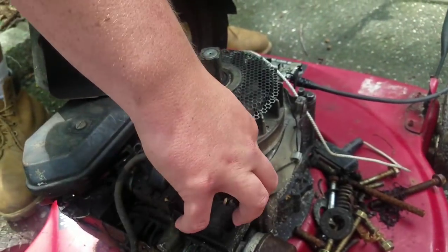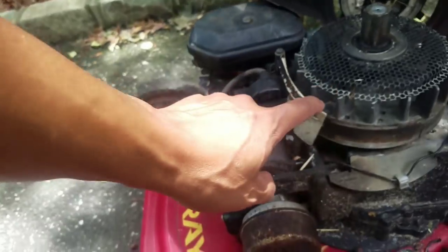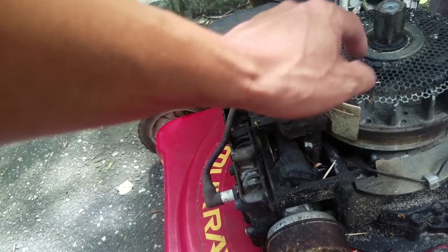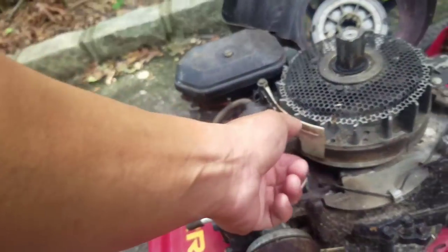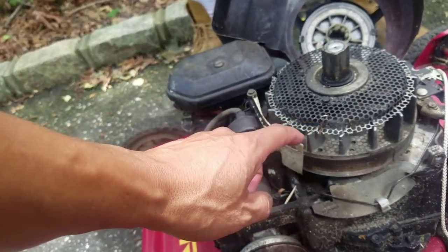The fan governor. Dude, you're right. I've never seen this flap here before. See, that's an old school governor. So how does this work? This thing rotates. An air vane governor. As fast as the motor spins, the blower blows wind on this, which will blow that, and it will stop at a certain RPM. That's cool. It kind of works like that auto choke system. Yeah, pretty much.